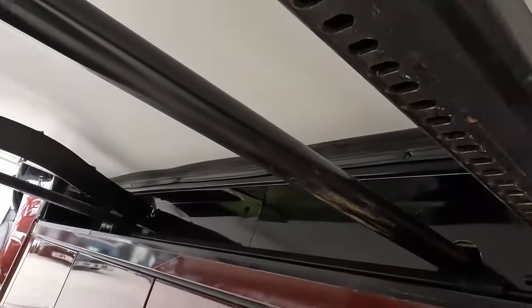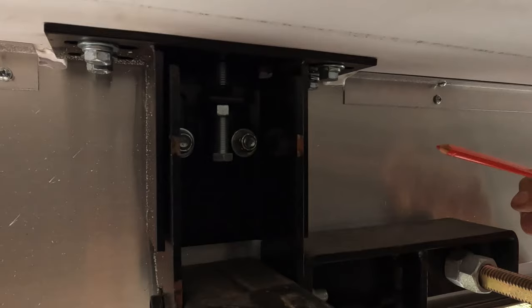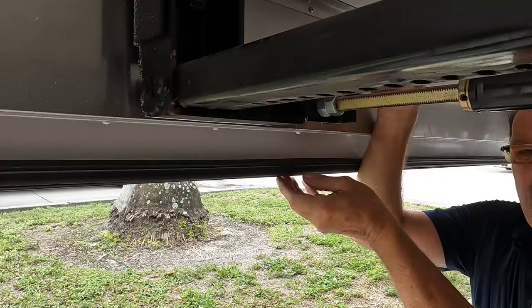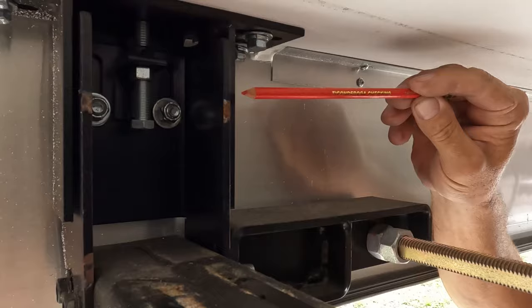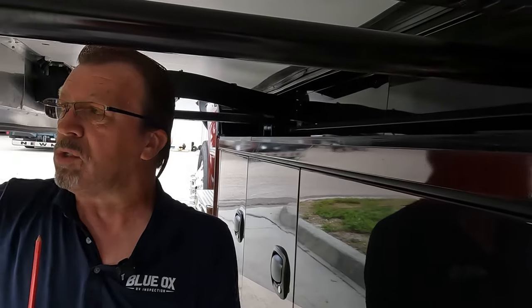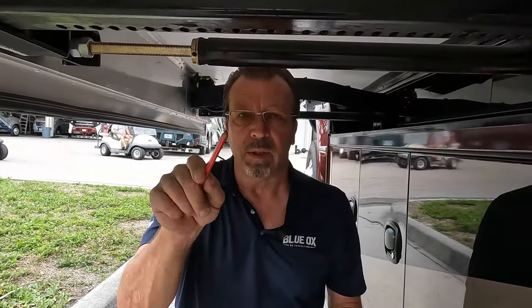On the opposite slide out we've got three cross members — you can see the hole where the gears drive to get the slide in and out. If you remember this morning I said how tight the bottom was to the surface — well, here's the culprit. See how it's chafing as it closes? There's too much adjustment bringing this slide in for no reason. The bulb seal is being squished, and with time it's going to rub right into the metal.